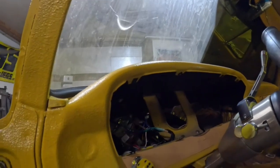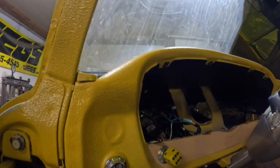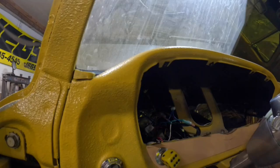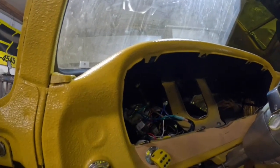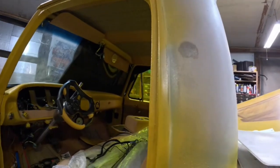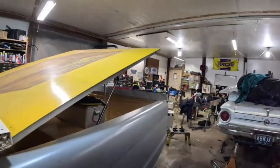And then tack is working. Everything's working, except for the dome lights and the headlight switch. So we're gonna get a new headlight switch. And we're gonna gather up all the wiring for the power locks. And then all we gotta do is zip tie some things underneath. Tie up the bottom: tranny cooler line, gas pedal, wires to the back.